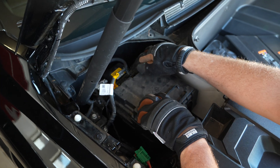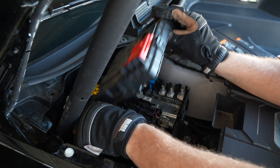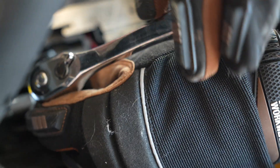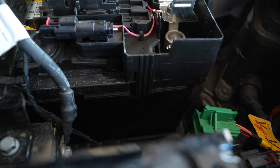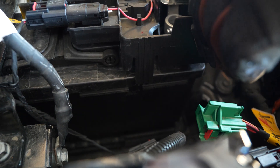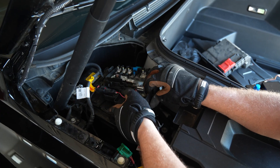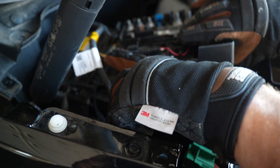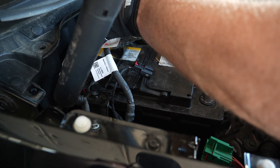We're going to remove this cover. The first thing we will do is remove the connector going to the 12-volt positive lug. With that out of the way, we'll remove this 10-millimeter bolt that keeps the clamp tight to the terminal. Once that is off, this whole thing is a little bit loose. There are two plastic clips — one on each side of the battery — that you'll need to work off. Get one side up and wiggle it over to the other side and it should come off. Now the positive terminal is removed, but to get it more out of the way, we're going to remove this connector by unlocking it — slide that red tab, then press the button and disconnect it. Then you can tuck that a little bit out of your way.